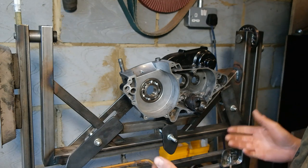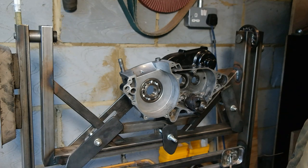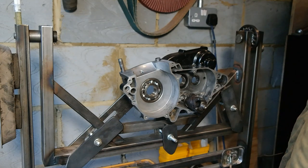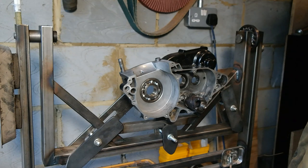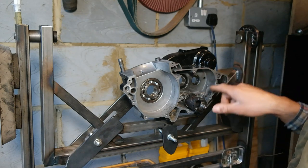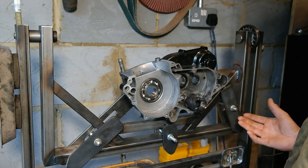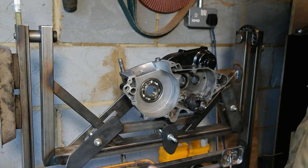I have a few things I want to do to this engine including the decompression for the cylinder head. I've also picked up a new project recently - a 1985 YZ490. To get started on that project I think it's about time we finish this one. We'll crack on with reinstalling the new transmission, get these two half cases back together, then flip it over and start doing things such as the clutch basket and the two crank seals. All the other bearings have been replaced - there'll be all new bearings, all new seals all around.